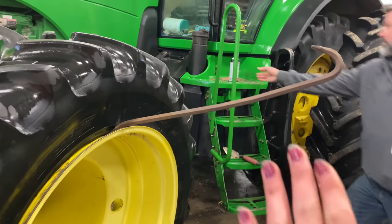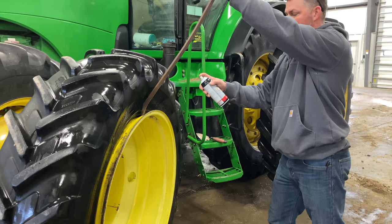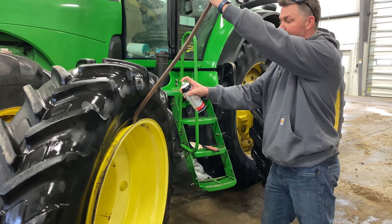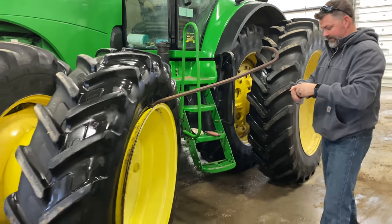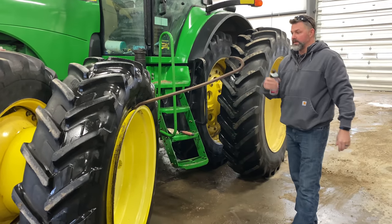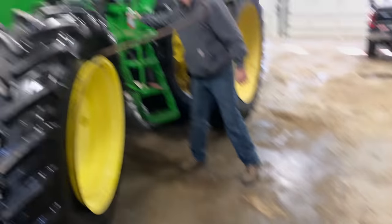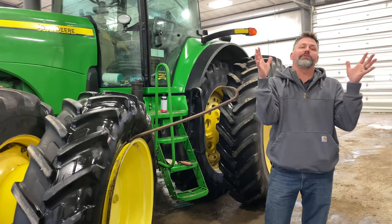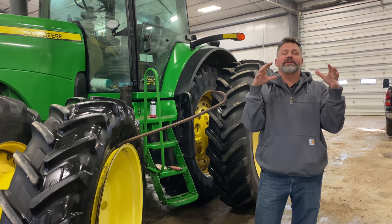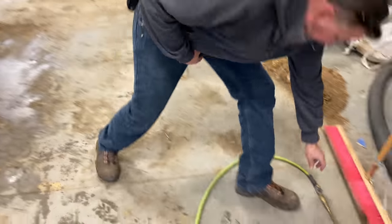And we have our crowbar here and ether starter. What is that? Both. All right. Put a little squirt. Okay. And by a little, I mean a lot. Okay, and so we put it all around, and then what do we do? Light it. Okay, how is air involved in this? Oh, we want to put the air chuck going. So as soon as the explosion happens, it's instantly inflating the tire. Gotcha. At the same time. So we start the air.